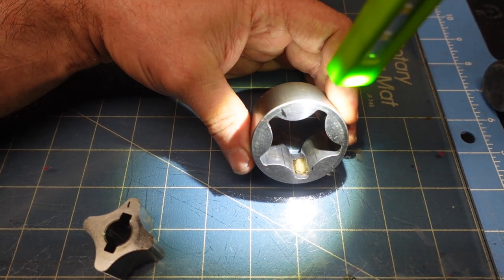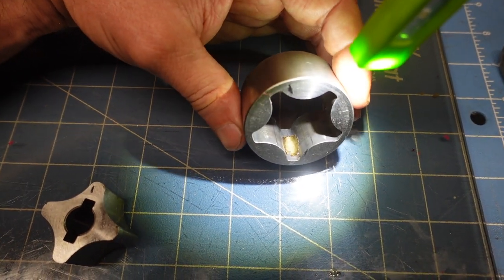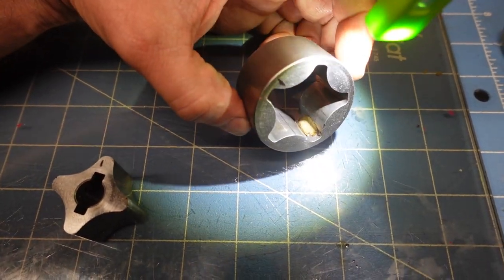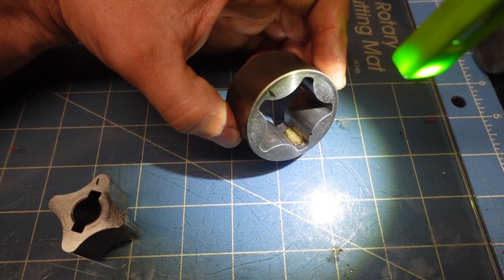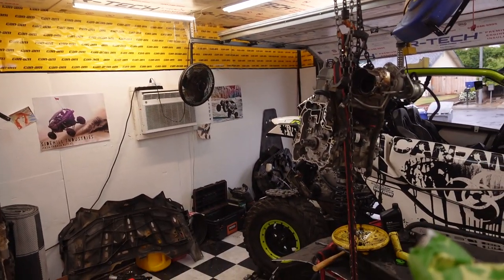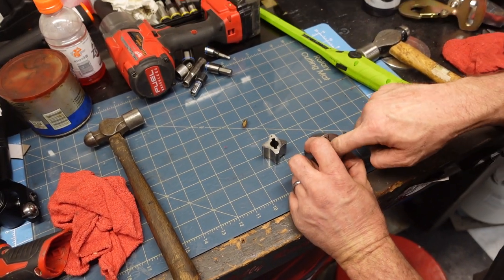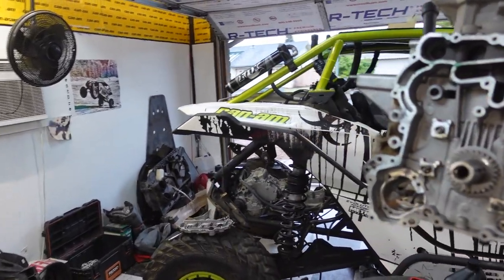There we go — do you see that in there? Oh yeah, that's definitely plastic wedged in there. If you look all the way around, the rest are good. A part of the plastic gear wedged itself inside here and froze up the oil pump as well. So again, hold the motor — we'll be back. Yeah, it wedged inside the oil pump and froze it up.